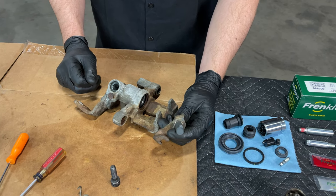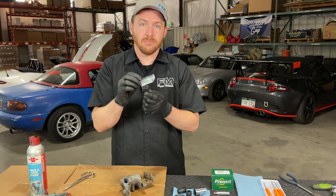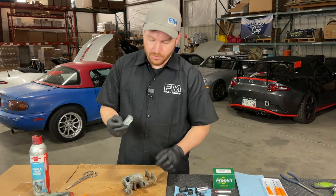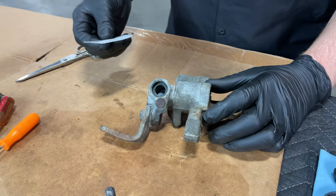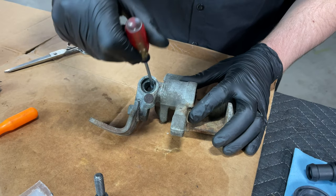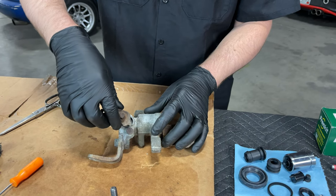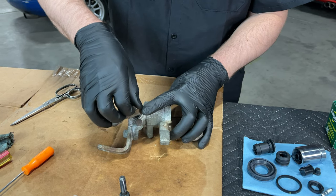Assembling the parking brake setup does require a little bit of grease. We're going to use the included grease packet — this is the milky white colored stuff, not the red packet. This is caliper slide grease, also rated for high-temperature brake caliper usage. I'm going to put a little bit down in the cylinder — not a whole bunch, because we want some left over for the slide pins — and then use a small clean screwdriver to spread it around. You can even use the pin that's going down there to spread it by rotating it around and moving it up and down.